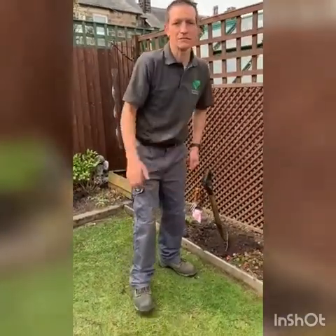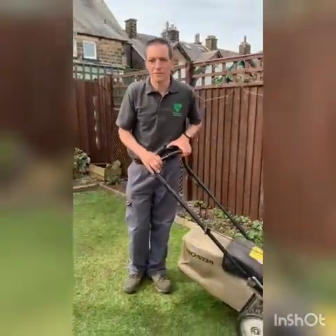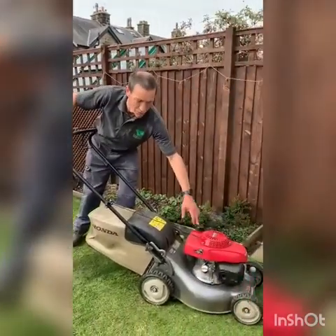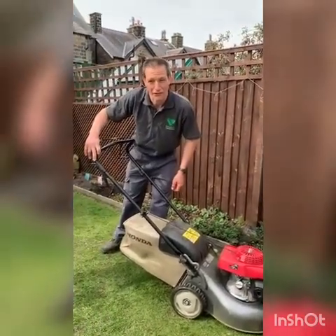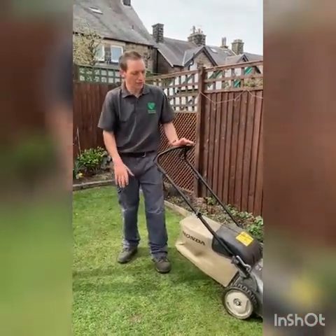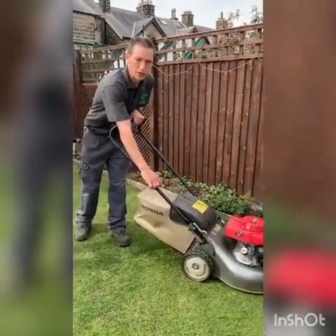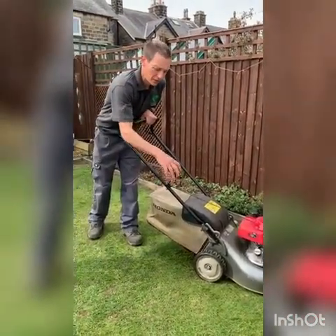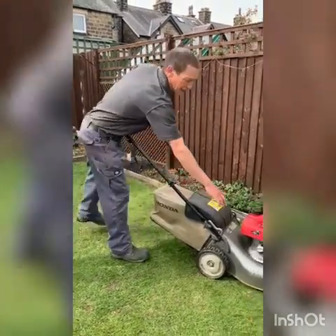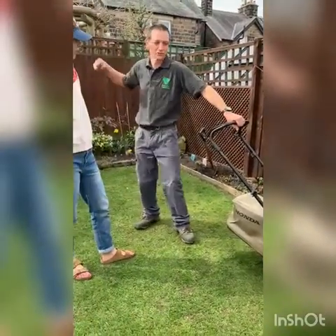Now, starting lawnmowers. When you get your lawnmower out of the garage for the first time in spring, it's always a good tip to put some fresh fuel in before you try and start it. Also, have your hand on the safety device. When you're going to pull to start the lawnmower, it's always good to have a pull start on your handle rather than one that's right down low, because otherwise you're already starting to stretch and you've got a long way to pull to try and start the mower.